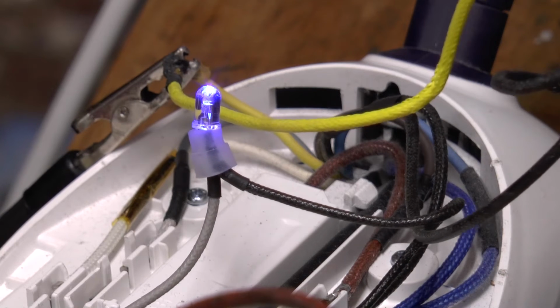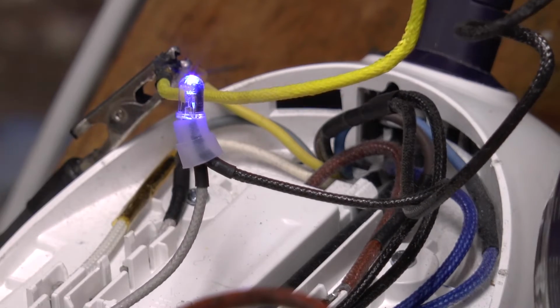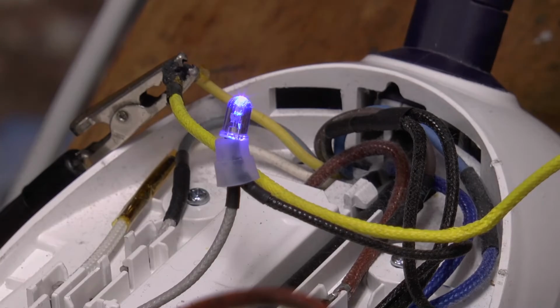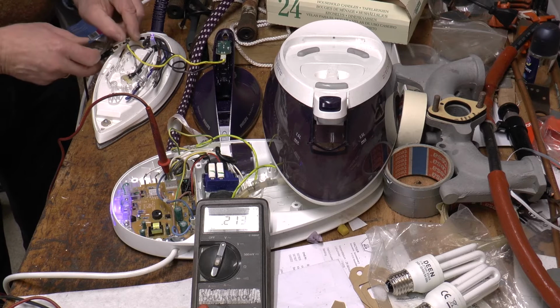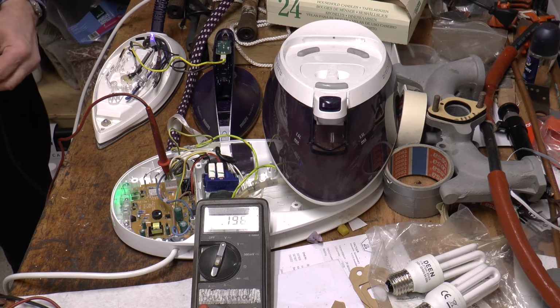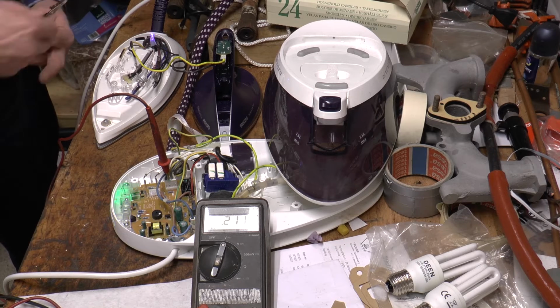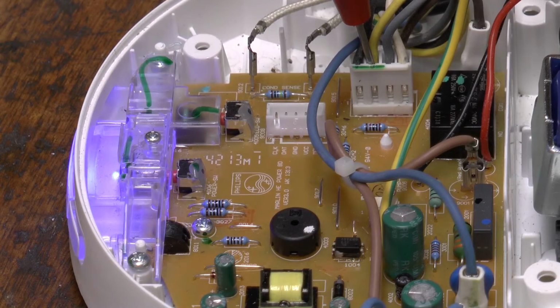And if I now push the steam switch, the machine will produce steam as it should. And to demonstrate that this is really the source of the problem, I now disconnect the bypass. You will see that the machine gets into fault mode straight away because the connection of the yellow wire has been interrupted. With a disrupted wire, it is not possible to reset the system. I will show that. So we now have the broken yellow wire situation.